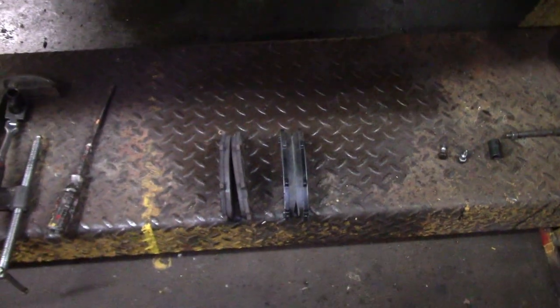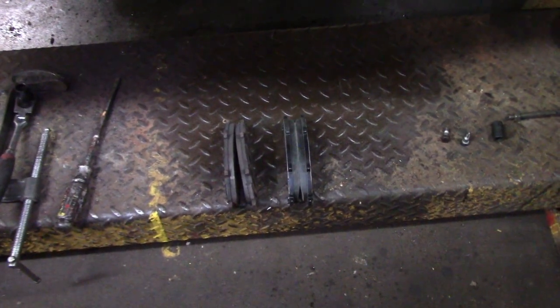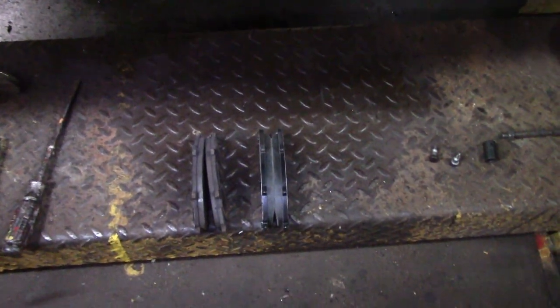But I'm glad I checked them, because if I overheated those brake pads and they start getting thin, sometimes they crack. They crack, and the adhesion of the pad to the metal bracket there comes undone, and then you kick the pad off and you got a mess. So hopefully this will avoid having to address anything at the track.